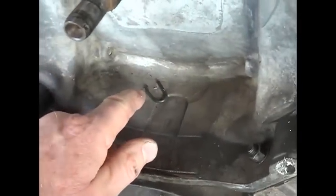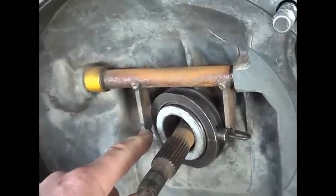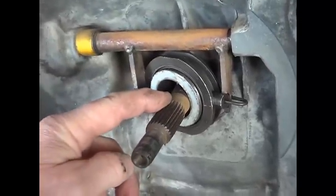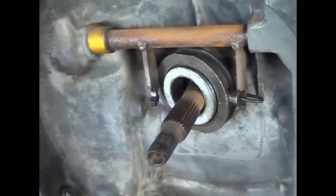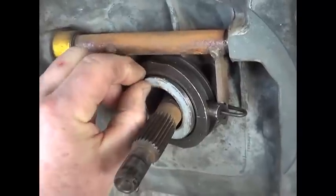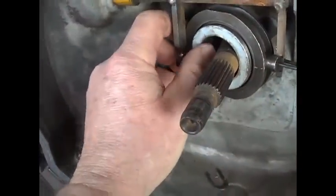This is a stock type retainer, and I got this transmission in a trade from somebody. I didn't have an extra throwout bearing for this early style — this doesn't have the sleeve. This is exactly the reason why you want the later style, because it has a sleeve over this and this won't probably ever happen. But this is what I saw when I took it off, and I see some kind of white stuff on here and I don't understand what that is. That's why the arm stayed forward — it got tangled up in here.